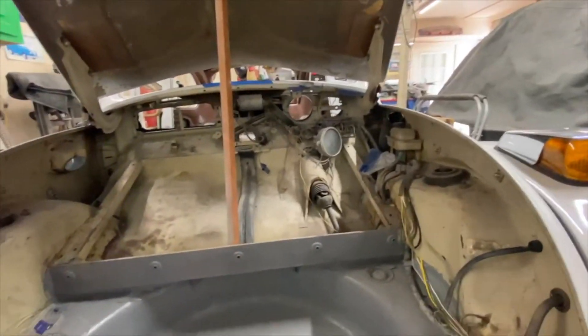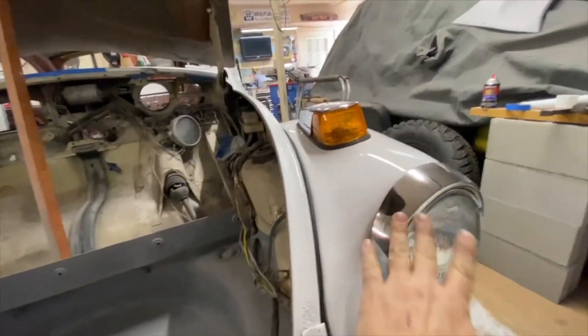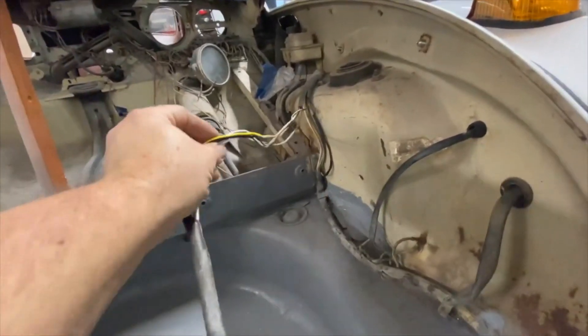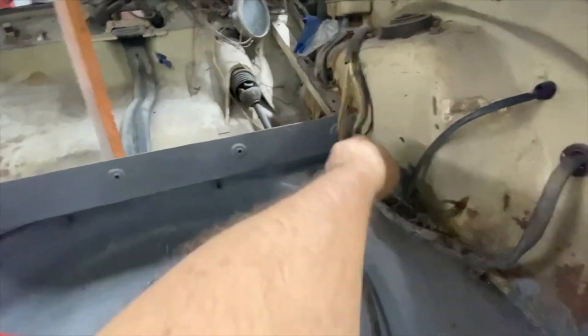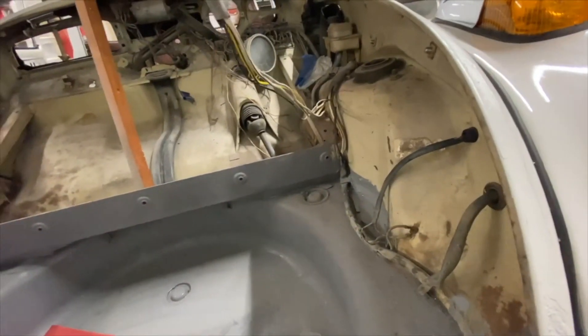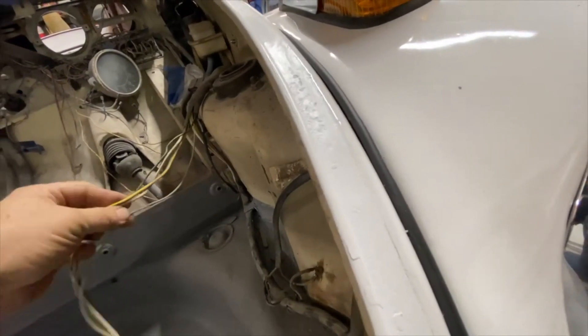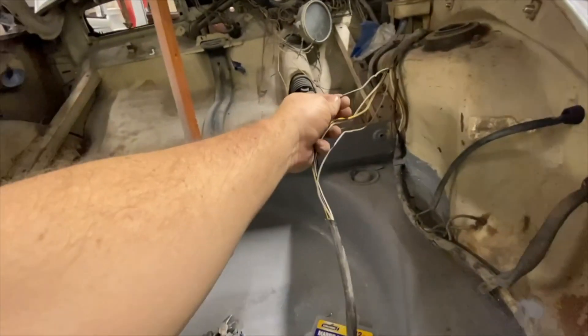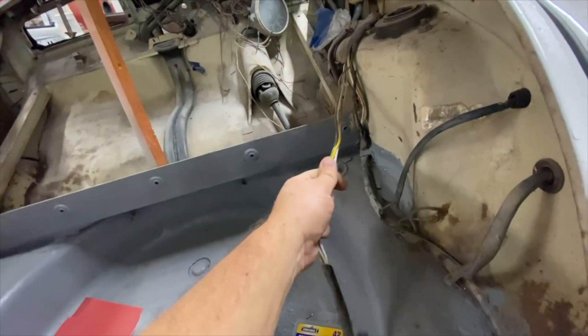Back under the hood - the headlight is installed and wired, the plug's fixed, and everything's coming through like it's supposed to. Found a bad wire in this harness that had burned up, so I'm going to patch that back together. Looking at the wiring for the other turn signal and headlight on this side, there's a place where it really got hot, like a direct short, so I'm going to have to remove this section and replace it.